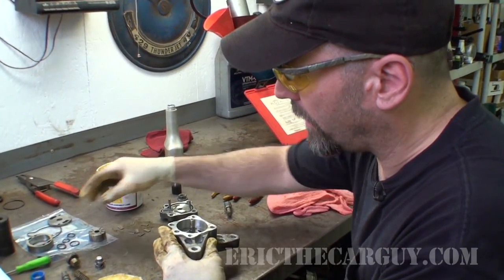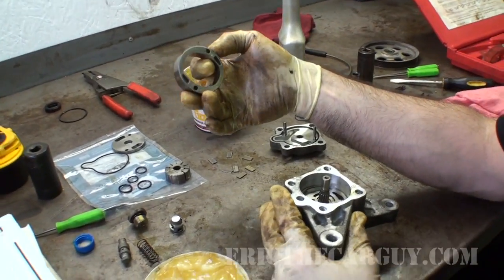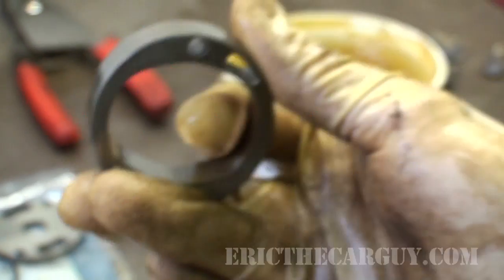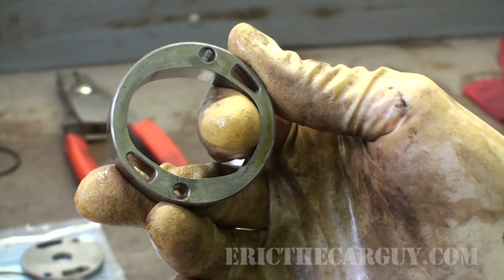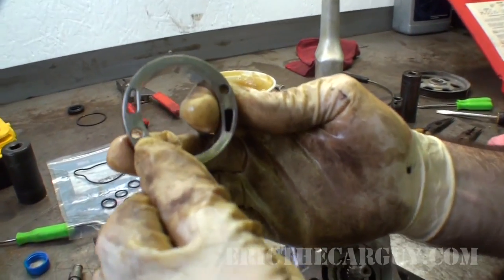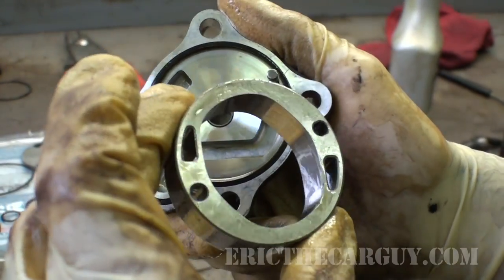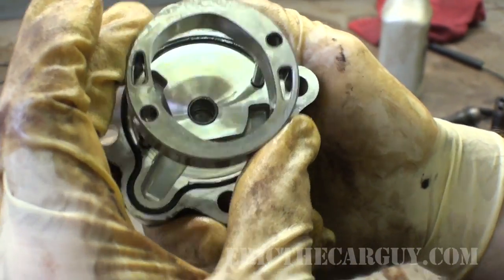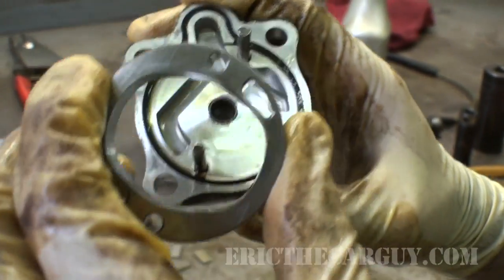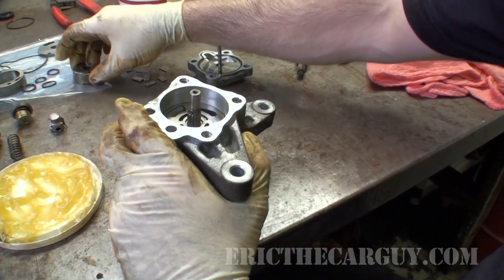So I'm going to go back to the other part of the pump assembly that came out, and I laid it out the way it came in. There's a little machined dot that's right up there in the top by my finger, and that side faces out towards the back of the housing. The opposite side does not have that dot. And also you'll notice that one of these holes is sort of elongated, and this one is just a straight hole. The large end goes into the cylindrical hole, the small one goes into the slotted one, like that. You try to do it the other way, it won't go together. So they were very smart in machining these things in such a way to where they only reassembled in one direction. For now, I'm going to continue to replace these vanes.